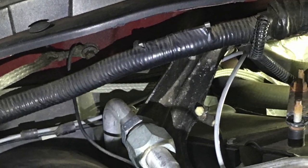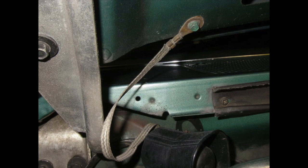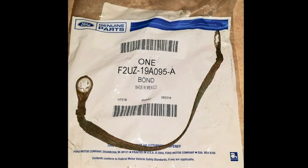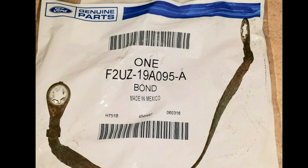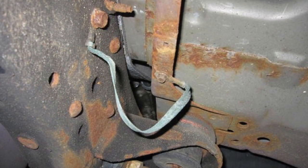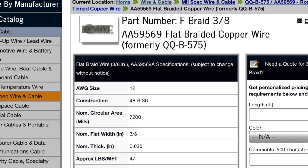We also have two other cables: the braided engine block to firewall cable, which is 26 inches long, and the braided frame-to-body cable under the passenger footwell, which is 8 inches long. Ford uses braided cables for bonding, to keep all metal components at the same electrical value. Bonding prevents electrical differences between panels that can interfere with radio and electronic equipment. These cables are labeled as bonding cables in Ford packaging, but are not identified in Ford's wiring diagrams and not listed in the current path — though as conductors, it's impossible for them not to be. In the next video, you'll see how these three cables — the two bonding cables and the 8-gauge negative lead — will act in parallel. I found a supplier who lists braided cable dimensions and relative cable sizes; the two Ford braided cables are each 12-gauge.